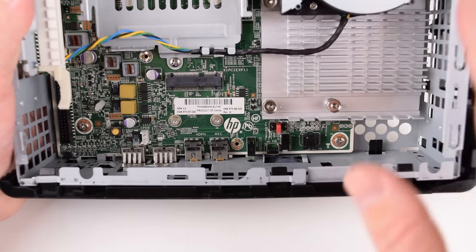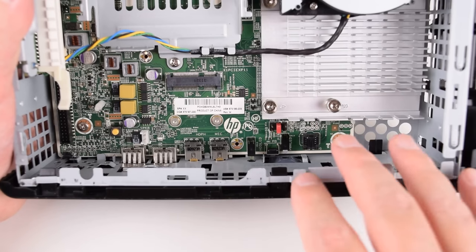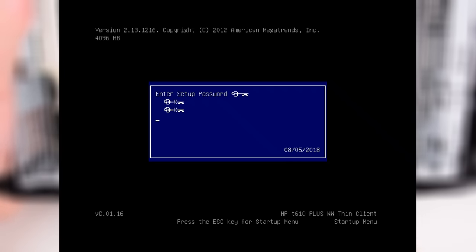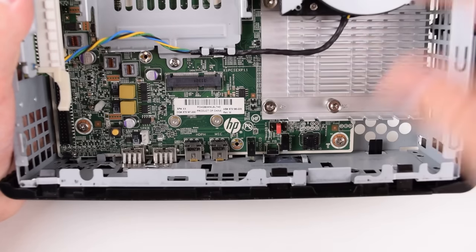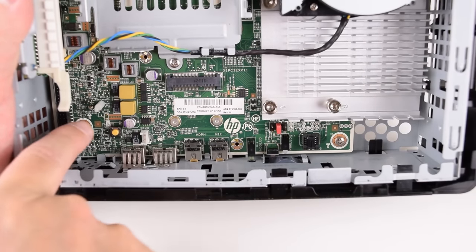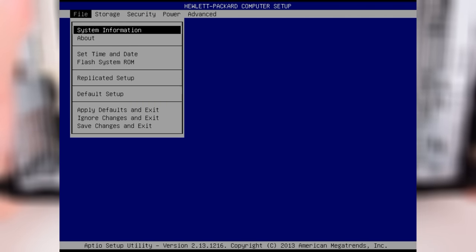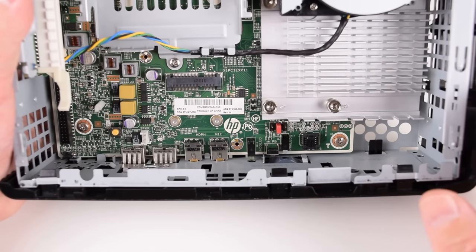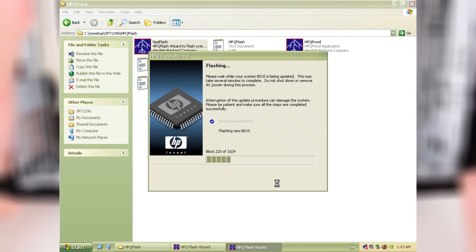So we had a quick look at the outside and inside of this machine. I ran into one little issue — there was a password on the machine, but that's not going to stop us. It's actually really easy to remove: you just unplug the power source, remove this jumper here, and then press the CMOS Clear button and the BIOS password was gone. As always, if it has a BIOS, we're going to flash it. I couldn't find a BIOS for DOS, so I just downloaded the BIOS update for Windows from the HP website and that worked just fine.